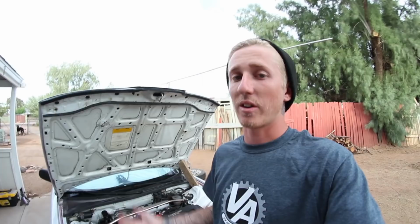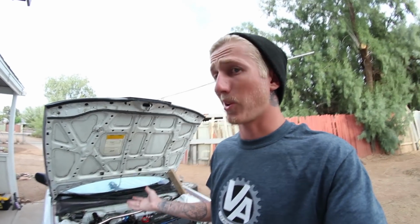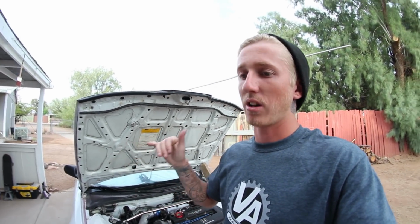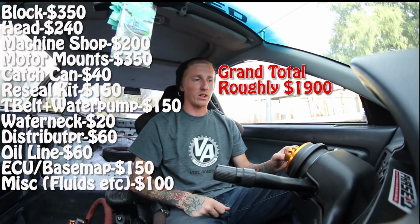ECU, I really recommend, if you plan on going further with the build, getting Hondata now instead of later. If you have the money, a Hondata S300 will run you around $300 or something. And then a base map, usually those run you right around $60 to $120 depending on the tuner or base mapper. So I'll add the things up here on the screen that you need.